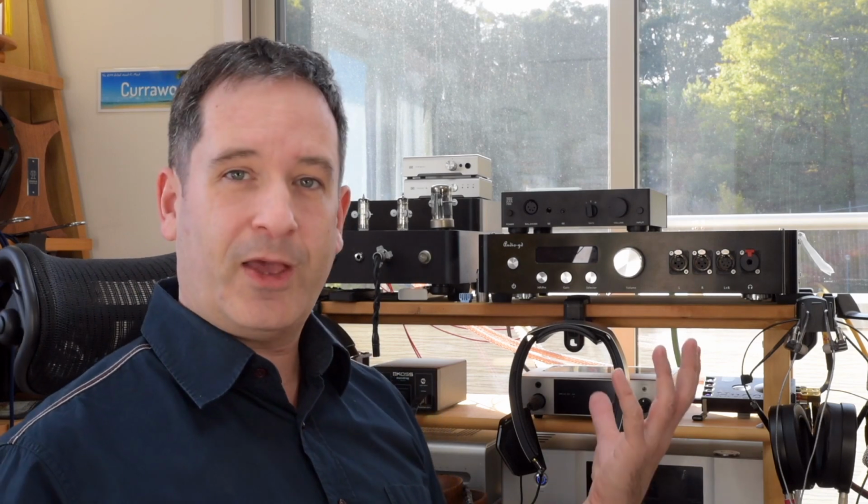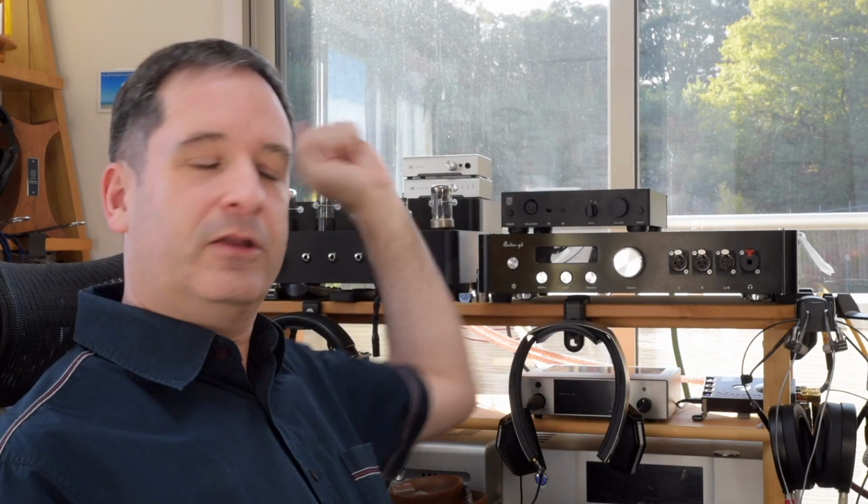1.5 watts of single-ended output is going to be way above any volume level you're likely to listen at, unless you have, again, something like the HiFiMan HE6 or Susvara. For most headphones, you probably won't even use anywhere near 0.5 watt of power, so it actually will be quite sufficient as it is. And again, the best amp I have here is single-ended.